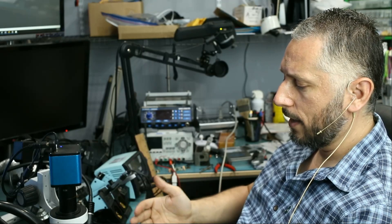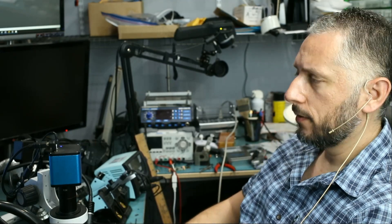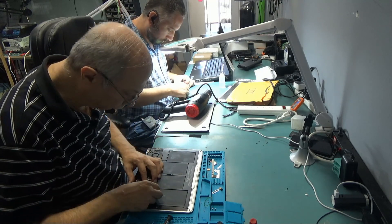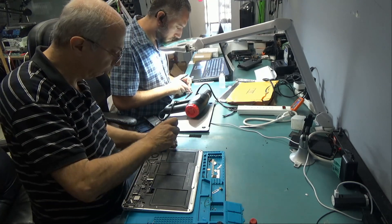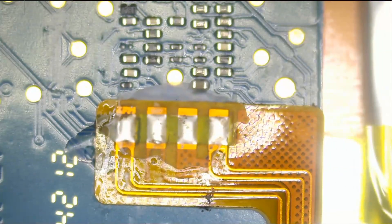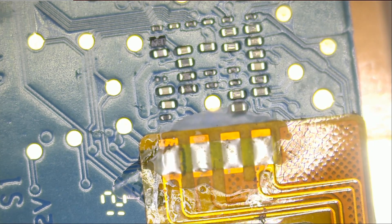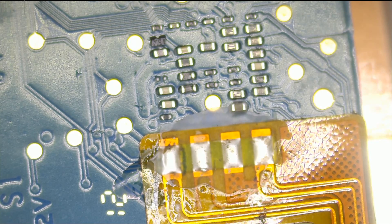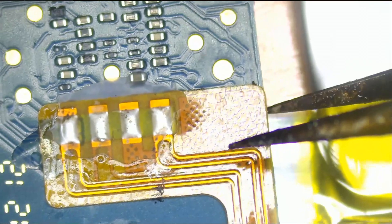So he's going to get both his data and a working iPod. Let's see how we go about changing the charging port on the iPod Touch 4. We have two things to desolder: a flex cable connector soldered onto the top left of the board, and the battery soldered onto the bottom of the board. The charging port is going to be even more difficult to deal with — opening the phone and taking out the board is one thing, and soldering the charging port connector is a whole different thing. It's a tedious process and it takes time.